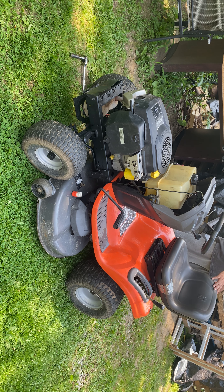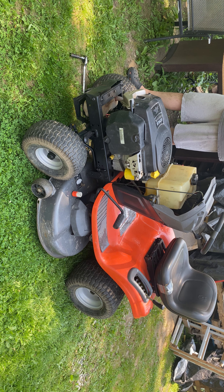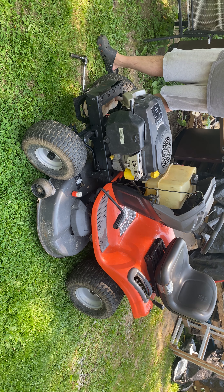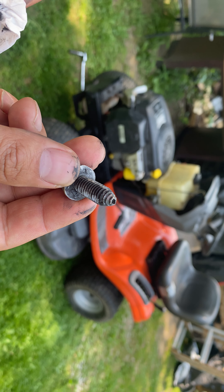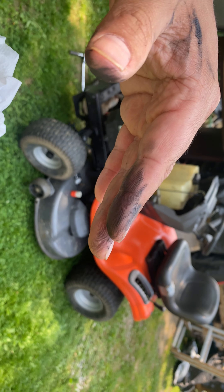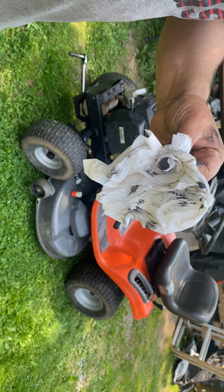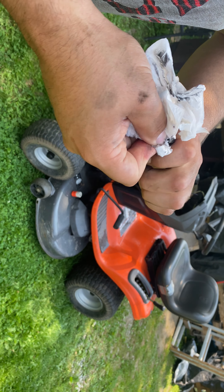Boys just got home — Buster's here, had to get them off the bus. They're good. So, this bolt's got a bunch of grease — pretty much caked in the threads, getting all over my hand. We're going to go ahead and go through the threads and get all the grease out, because we don't want grease — we want the threadlocker to be able to work. If there's grease all in the threads, the threadlocker is probably not going to work.